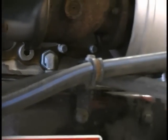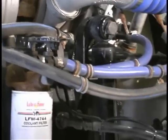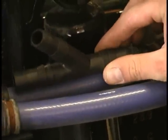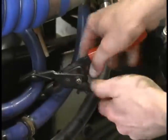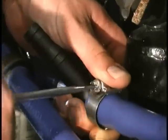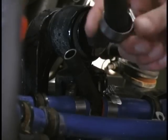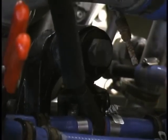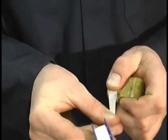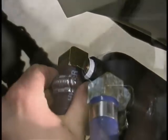In this video, we are going to connect the heater so that the coolant will be taken from a high pressure coolant line coming from the rear of the engine. To access the coolant from the rear of the engine, use a Y connector. Clamp off the hoses if you have not drained the engine coolant. Install the Y connector and clamp on the coolant hoses. The coolant will be returned from the heater to the low pressure intake side of the engine's water pump. Before removing the fitting from the spare port, the engine's coolant will have to be drained. Replace the plug with the required fitting and be sure to use a sealant on the threads. Now connect the coolant hose and clamp it.